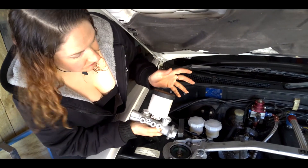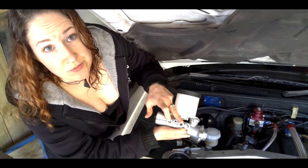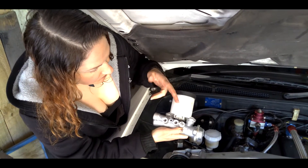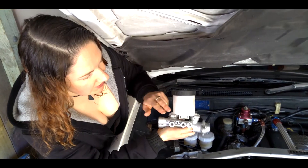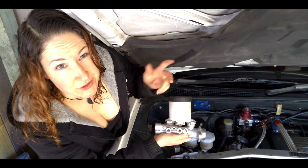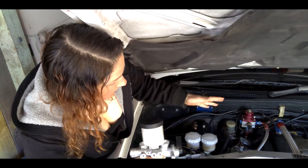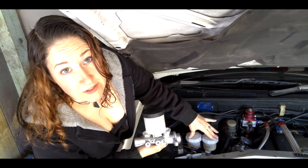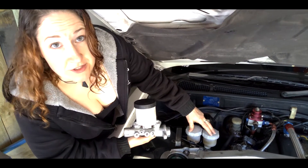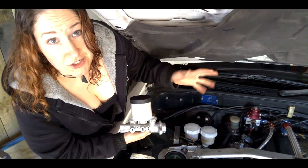To help you get an idea of brake bias and what that is, here's the original single master cylinder that we had. You can see the two ports here for front and rear — you can't really adjust the bias with a single cylinder. You can get a valve and reduce your rear bias a little bit, but it's not going to be nearly as effective or efficient as having two separate master cylinders for your brake system. Here we have two master cylinders, one for front and one for rear, so the systems are independent of each other and you can adjust your bias accordingly.